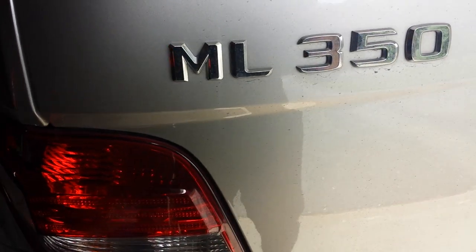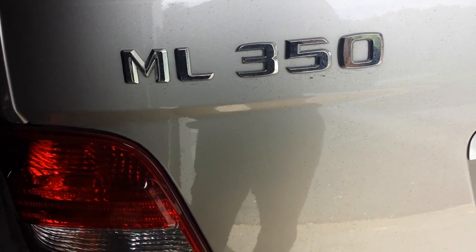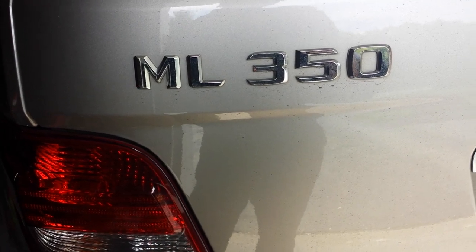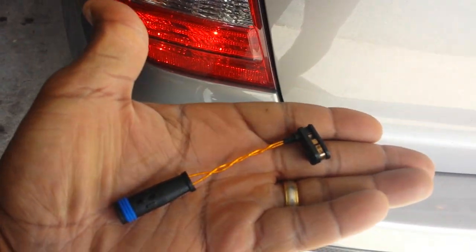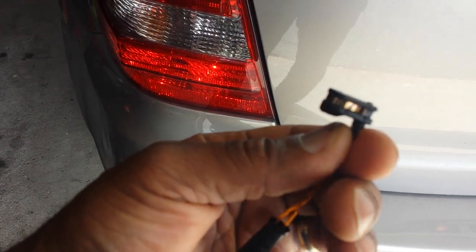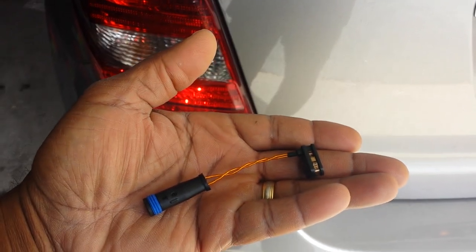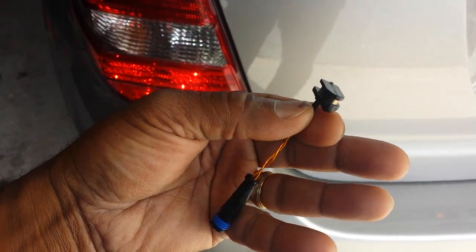Usually when that brake sensor visit workshop comes on, it means the brake sensor is now damaged as well. It's made to make contact when the brake pads are very low, and it's a plastic piece in between two metal pieces. This is what the new piece looks like — this is the sensor part that senses the lowness in the pad, and this is the electrical connection part. So we're going to replace the pads that are low and also see if we need to replace this piece.